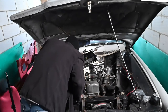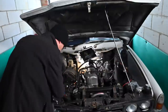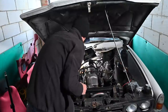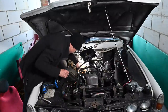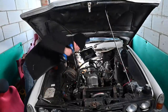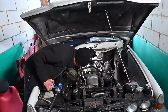Back to this one which is causing me grief — it's a much smaller bolt, to be honest. This one seems to be 9/16ths on the top but I've only got one 9/16ths, so I'll have to go with 15mm on the bottom. It's awkward because the fuel pump is on the front, the oil filter is above it, the dipstick is behind it, and from above there's the hydraulic cable for the clutch slave very much in the way. Everything is not awesome. It's turning — but it's just loosened it in an annoying manner.